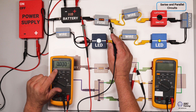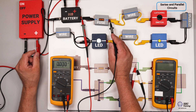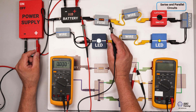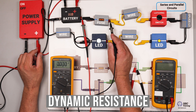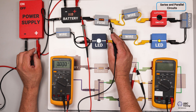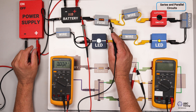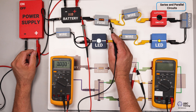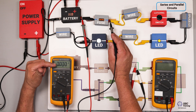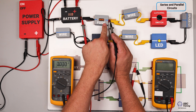What we're seeing here is a value of 0.000 volts DC. A voltage drop test is essentially a way to measure dynamic resistance — the resistance in the circuit when current is flowing. Even though I'm not on the ohms symbol measuring resistance, I'm inferring the resistance of the device based on this voltage value. A zero reading tells me there is very little resistance in this fuse.